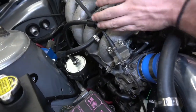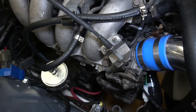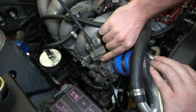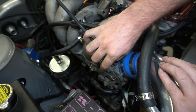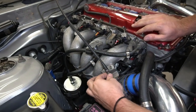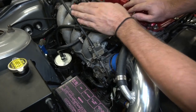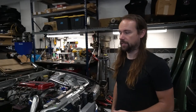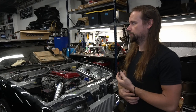This is an OEM dual cam throttle cable on our bracket. As you can tell, the threads sit a little further back than on the aftermarket one, so it's bolting on the very bottom of the throttle cable mount — it looks a little odd, but it'll still work as long as you put blue Loctite on there. Personally, I'd get rid of the old one and just get a new cable, because these are old anyway and probably stretched. That's our warning: if you're using an old dual overhead cam throttle cable you might have fitment issues, but you can use the new aftermarket ones.